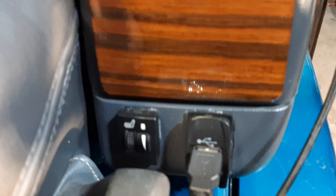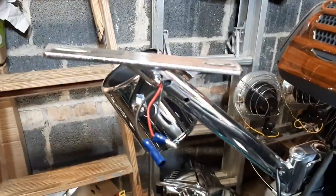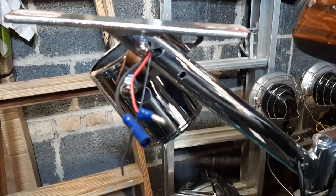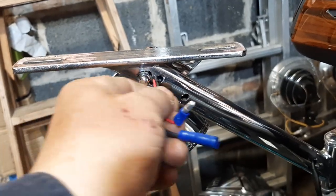Behind the bracket here, I went out the existing hole I already had in place for the USBs and the two-zone seat heaters. It looks like this before you put the armrest back together — pull all the wires, place it, tighten it all up. I just used a 1/8-inch drill bit for a pilot hole, and I stretched out the hole with a 3/16ths bit so that I could move the wires around.